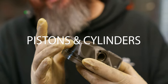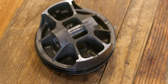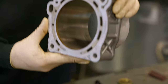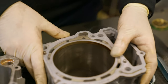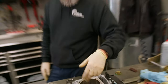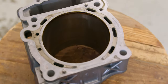Usually the piston skirts are where you'll see a lot of scratches and stuff. These piston rings rotate nice and smooth. We're still going to put in new rings just to rebuild the motor. There's a nice crosshatch on the cylinders. On a motor that's more worn, what would you expect to see? I used my dial bore gauge and checked it at six different spots — to see if it's round, to make sure there's no uneven wear.